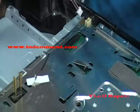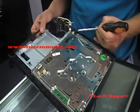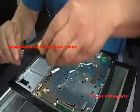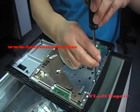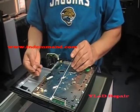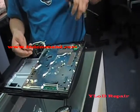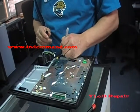For the motherboard, or the actual logic board, there is a total of seven screws. These are four larger screws on this side — take these out. Just remember, there's three M screws, marked with an M. There's one here in the center, one here, and one here. I actually used the Sharpie and marked where the M screws go so I remember where they go — they're the only ones that are different.